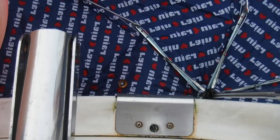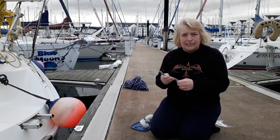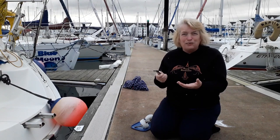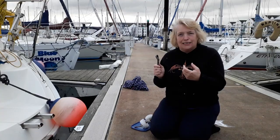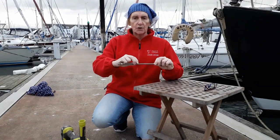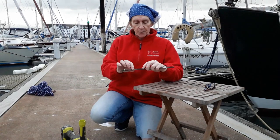I dropped a washer, but the brolly saved it. To help with this job, we bought some ratcheting spanners and they are great because they help you undo nuts and stuff. The only issue is you need a lot of space. When you're working around the engine, they're quite bulky, but they're great when you've got the space. So what I've done is I've taken the old bent rod, marked it a little bit longer where it needs to be, and I'm going to cut it just there. I've left a nut on the rod so that if the threads get a bit bent, I can straighten them up by just running the nut over them a few times. I'll probably tidy it up with the end of the grinder.